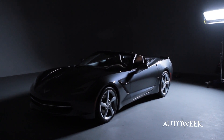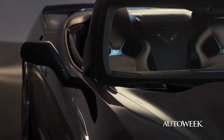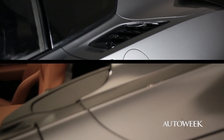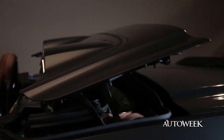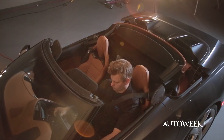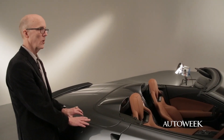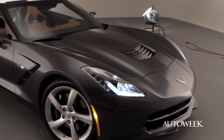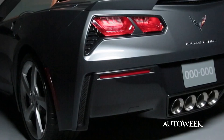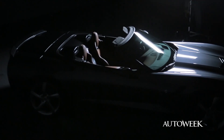Another difference between the convertible and the coupe: that inlet vent near the rear wheel that we spent a lot of time talking about for the coupe is not there. We spoke earlier about designing the two configurations together, and one of the elements of doing a convertible is how the mechanism works, how the tonneau goes up and down — and it's tough to occupy two different functions in one area. So taking that into consideration, we optimized another course to route the air up and through the coolers in the rear, primarily underneath, and we optimized that configuration for the convertible specifically.